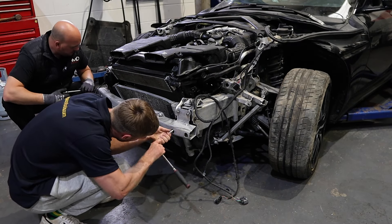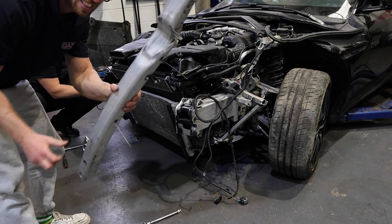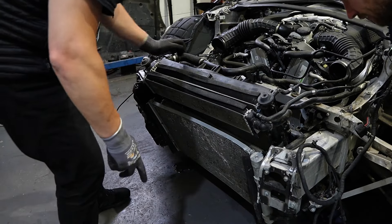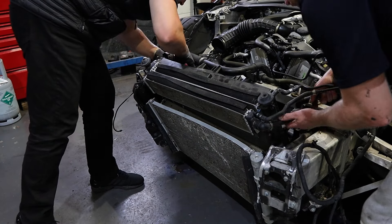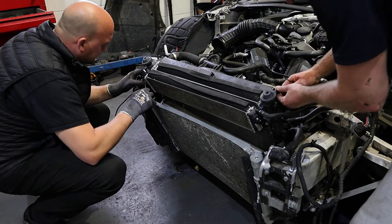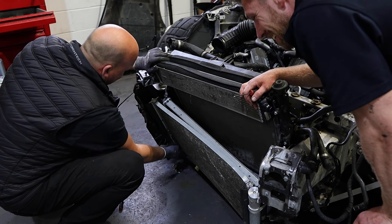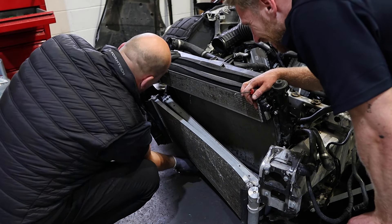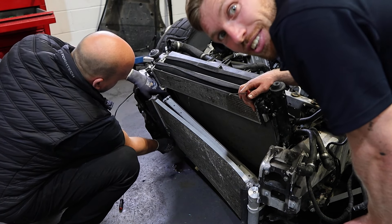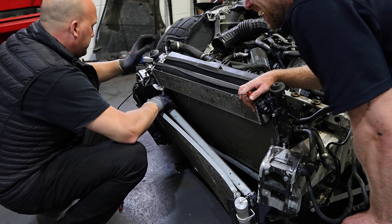The first thing to do is start removing everything to see exactly what is damaged. We're going to remove the front crash bar, which is held on by four bolts on either side - it's bent. Then we can remove the two air boxes. There's a huge puddle of coolant on the floor so we know the radiator's been punctured, so we need to start removing the whole rad pack. Luckily there's no aircon in there.